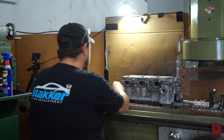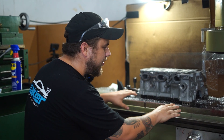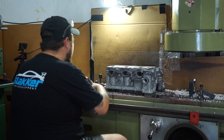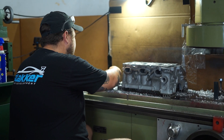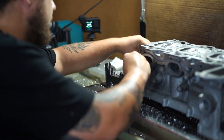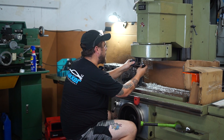The first thing we want to do is get it set up. These heads have dowels on the bottom — it's a pain to take them out, so it's way easier to leave them in. The only issue that causes is when we surface it, we've got to put them up on these three blocks to get them off the dowels. Once we get it clamped down, we're going to send an indicator across it to see what kind of deviations we have and try to get it as level as possible.